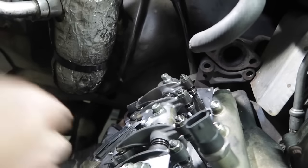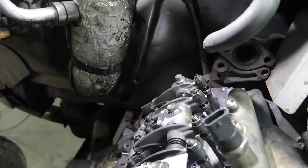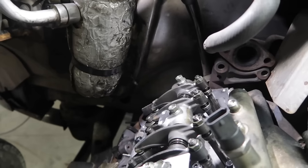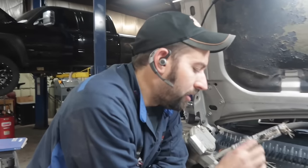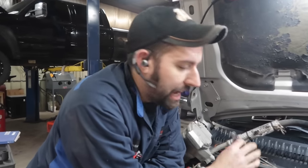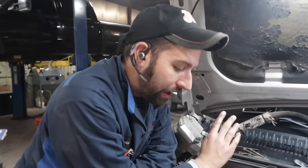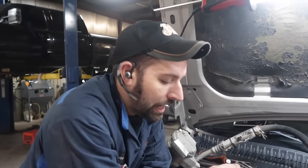One thing to point out too, guys, if you're taking your engine apart for head gaskets or whatever it may be, always really good practice to always adjust your valves no matter what. I've had guys in the past tell me, oh, I don't need to adjust the valves, they didn't machine the head, we put a different gasket in. I even put the same thickness gasket in. I don't care what you're doing, if you're pulling the valve train out, always readjust the valves.